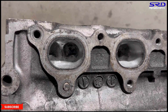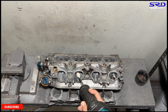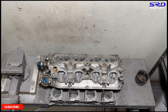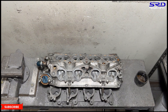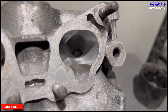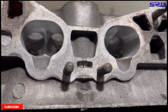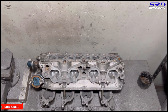You can see it's slowly starting to look like a good and proper exhaust port — but not yet. Now let's go to the intake roof. We're trying to blend the port side walls onto the roof so it transitions really well on the shape. We keep making passes — this is still 80 grit, by the way — until we get the desired shape we need. You can see the port side walls are taking shape, and it's not totally hogged out. We're going for the ideal shape and finish. Even the port floor looks really good. Now let's go to the bowls.